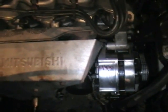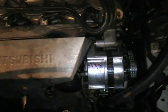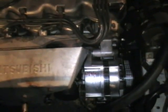And with no power steering there were lots of roundabouts, about 4 or 5, and many corners I had to get around, so it made it quite hard. You have to go about 40 to 50 kilometres an hour around roundabouts to steer properly, because any slower than that and you can barely turn the wheel on this car. It's obviously not a well designed power steering system as far as failure goes, which I suppose is not designed to fail, but it was barely turnable at low speeds. Trying to manoeuvre in a car park where I stopped to inspect, it was virtually impossible.